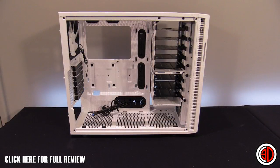For a water cooling configuration, moving all the hard drive cages to the very top gives you around 100mm of room at the bottom — easily enough for a 60mm thick radiator and a single set of fans. You don't need to run both the five-bay and three-bay; you can just have the five-bay at the top. It's very modular. In this config though, the five-bay needs to be at the top because it has the mounts that reach down to screw into the front and top.